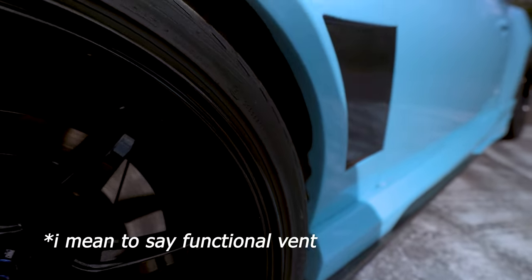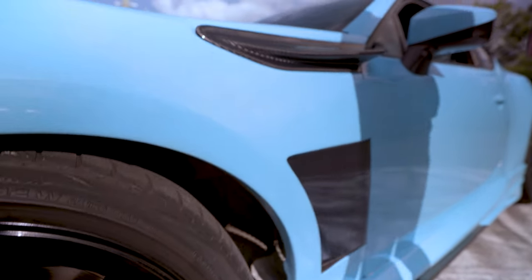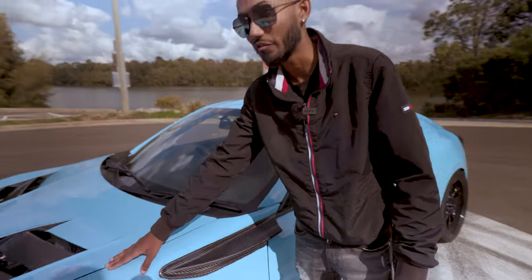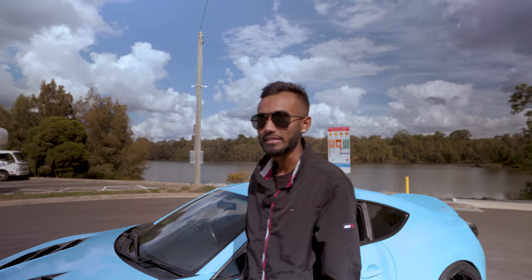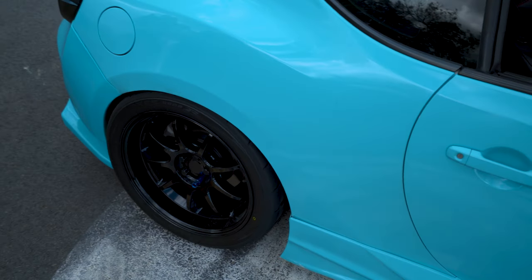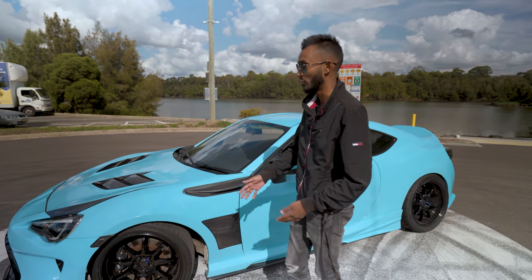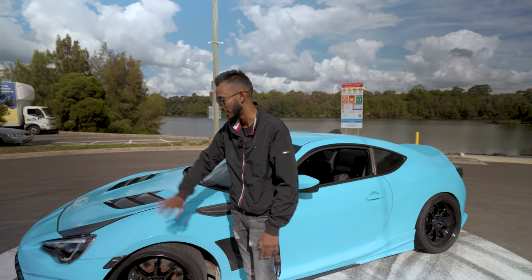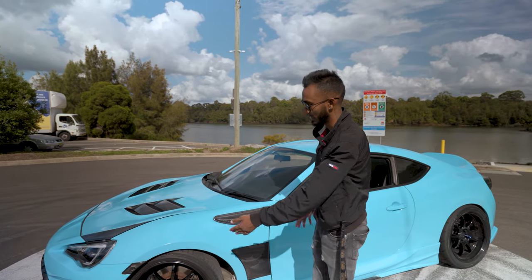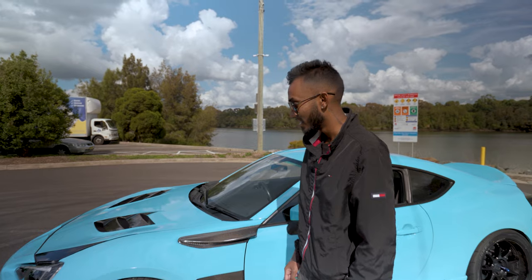And I noticed that even back here, there's a cooling duct behind the wheel. You can see the whole chassis underneath because you guys took off the lining. Yeah, because it is running a bigger guard size we did have to take the lining off. The only downside is that it does flick rocks into the engine bay and makes it a little dirtier. Because we're running bigger brakes and more power, we're anticipating more track days, so removing the lining actually gets a lot more cooling going into the brake itself. It's a bit lighter as well — saves a few extra kilos.